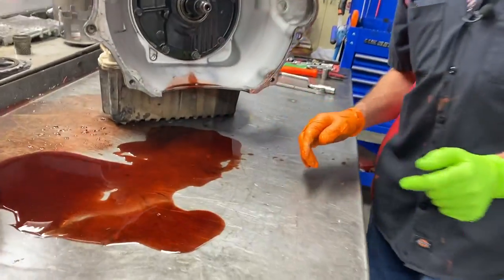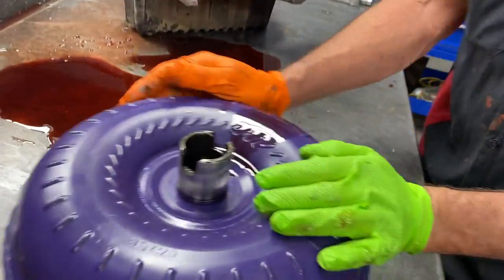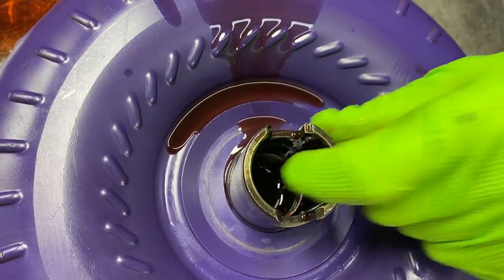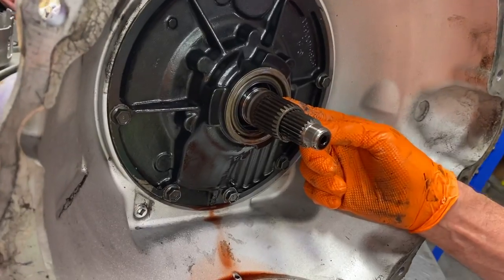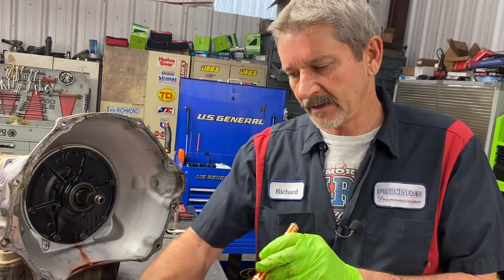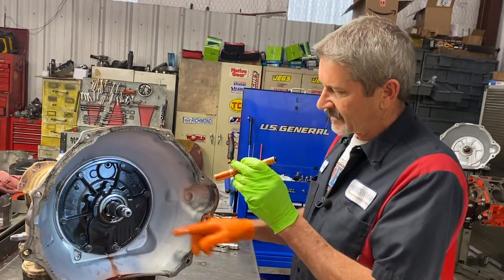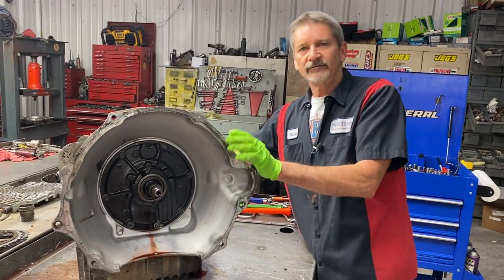The foot doesn't look too bad, but the pan's full of metal. Now we want to look in here and see if it's a true 48RE converter. If you stick your finger down in here, it physically has a stepped hub in it. So when you have a stepped hub here, the stator won't have a ring right here - they have a groove for a ring, but with a stepped hub you can't put a ring on the stator, so they left it off. Being this type of vehicle, you'd think it would have a full-length hub and a ring on here, but I don't understand that. They said it was leaking out of the front, and he said they went to the races and something started happening - tried to come back with it and left them stranded on the side of the road.